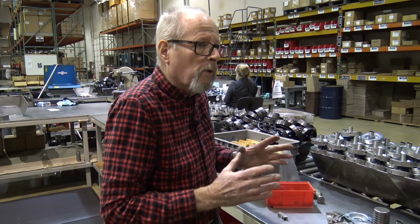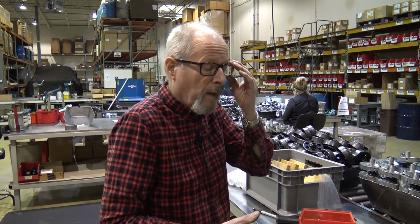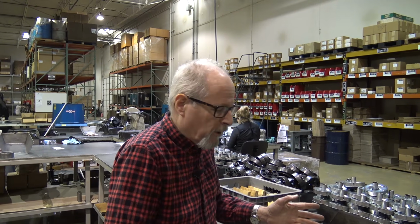3,000 is typical for all of the clone engines, be it Briggs & Stratton engine or the Honda clone, the Raptor engine. The engines that they race with are now torque engines, whereas the Briggs & Stratton flathead used to be an RPM engine. You wanted the clutch to engage in excess of 4,000 RPM. Today's racing engine, you want it to engage between 3,000 and 3,200 because it's torquey, it's not an RPM screamer.